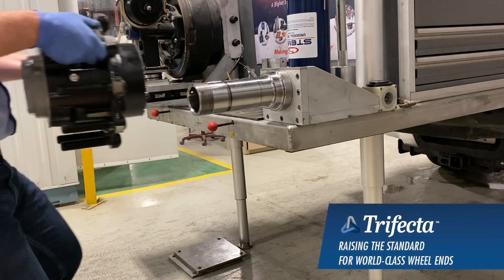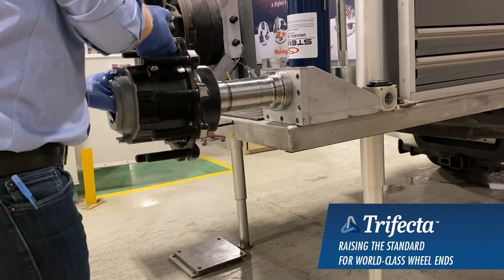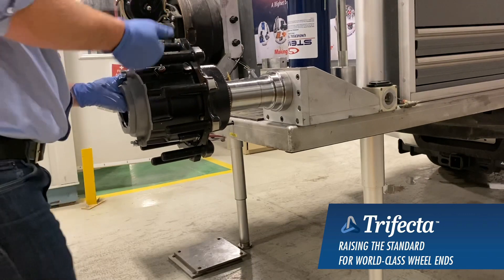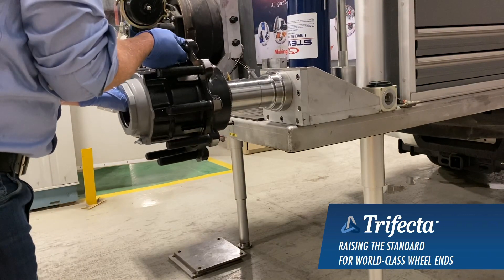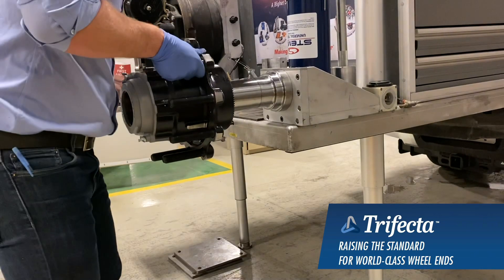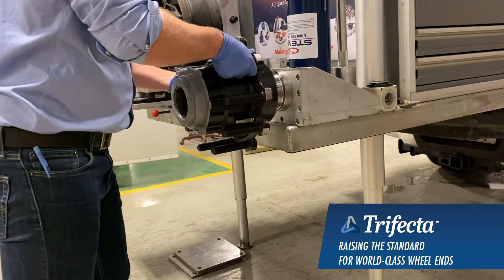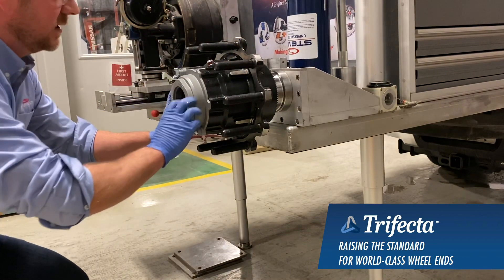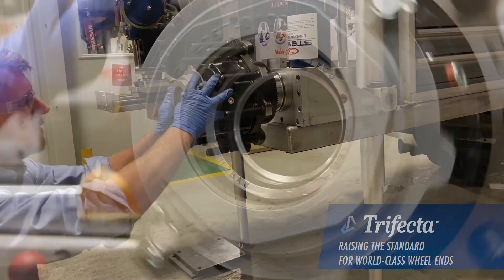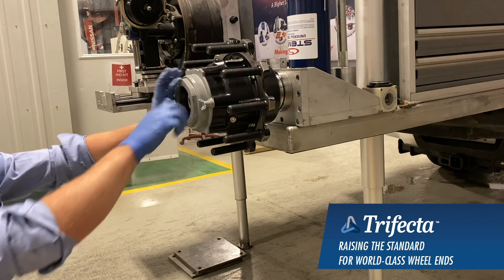Get the hub assembly and line it up carefully on the spindle threads. Because there is a spacer cone in it, you're actually going to need to use your fingers in there just to hold it up a little bit and guide it over the threads. Carefully line everything up, slide it on, and you'll notice on the Zip Torque there's a tang that will catch — that's the mechanism that allows you to tighten on.